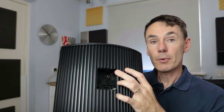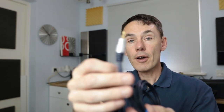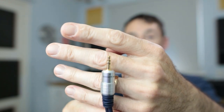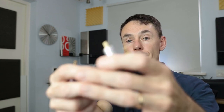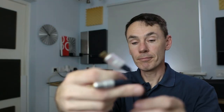This is where it gets a little bit different from what you might expect. That RCA line socket at the top is the one that's used if you want to connect to anything non-Bang & Olufsen. So if you want to connect those speakers to a phone, an iPod, a laptop, a Sony television, anything that's got a headphone socket, an AirPort Express, a Chromecast Audio, a Bluetooth receiver — the list goes on and on. This would be the cable you would use: a mini-jack headphone plug to go to the music player, and then two RCA phono plugs — also known as Cinch plugs — at the other end. They split out and one goes to each speaker, into that little line socket at the top. These speakers don't connect via their Powerlink sockets when used with a non-Bang & Olufsen product; they physically won't switch on that way. They have to use the RCA socket.